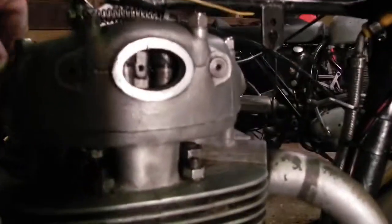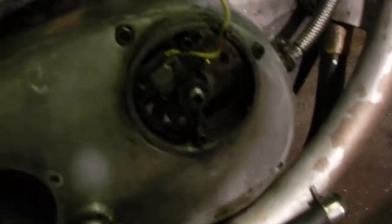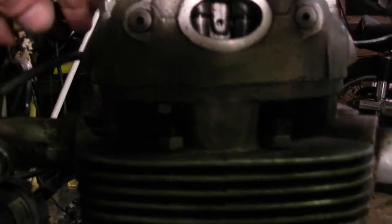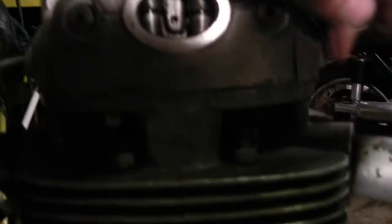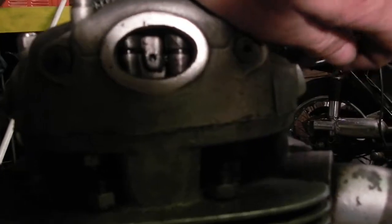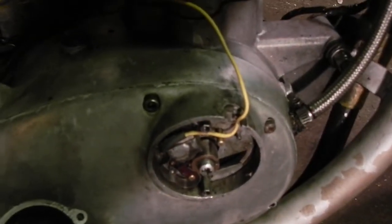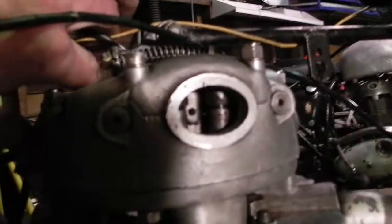What we have on the bike right now — and I hope somebody can identify this, because I had another friend look at it as well — is both push rods near top dead center, and this is on the opposite firing sequence, 180 degrees basically to the firing sequence, but both valves are open. We have tension on both push rods, so they are both open, no play at all. I'm not sure both valves should ever have that much tension at the same time. I have these adjusted properly because there is a point in the engine where they are both closed at one time, but it does not seem to correspond with the right point on every revolution — maybe every other revolution. So that's our problem here.